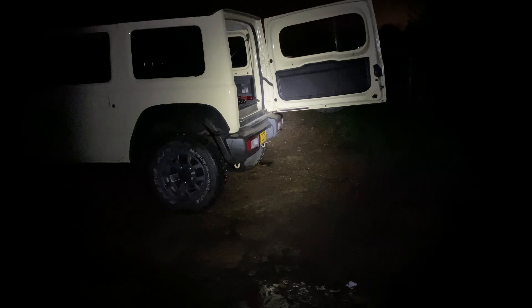Only a few complaints for this light: because it runs on three triple-A's, the runtime is pretty poor compared to a good 18650 light, despite having very similar dimensions. I'd love it if Maglite made it so you could run it on either battery source. There's also some PWM visible when dimmed down — not the worst I've seen, but it would be nice if that were better. The biggest downside is the electronic switch: if you leave it with batteries in, it will go flat. It's no good as a backup light left in a glove box or drawer.